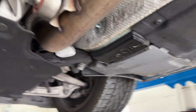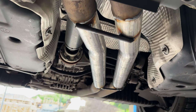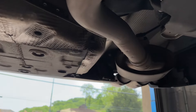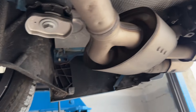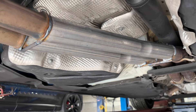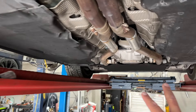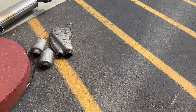It's got factory converters up there on the manifold, then it had two resonators there — we took them off. Had two more resonators there — we took them off — and ran true duals all the way back into his valve mufflers. Look at the baby mufflers. So when the valves open, it becomes almost straight pipe. The resonator on this side was a dual-in, dual-out — one single big one — and then there were two baby resonators there.